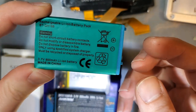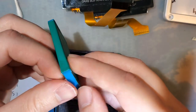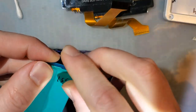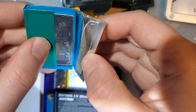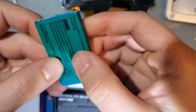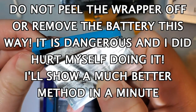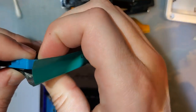I've taken apart a few of these before. One more thing — you can see the wrapping is just on there terribly. I had to actually peel it up and rewrap it on one I'd given away because the battery didn't even fit in the compartment. The only thing these things are good for, in my opinion: take the wrap off, salvage this frame and the board in here that has the contacts, solder one of these new cells to it — that's how you get a decent battery out of these.